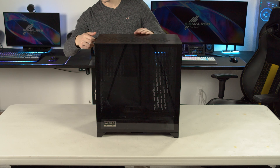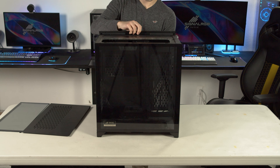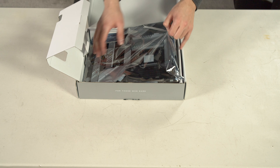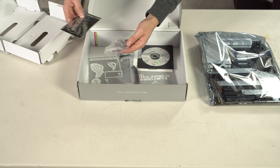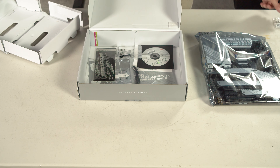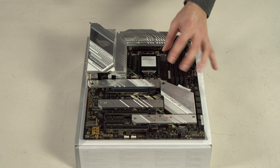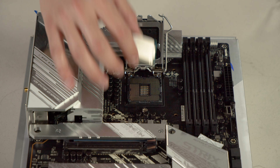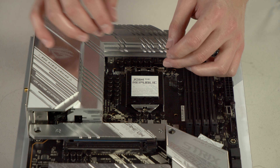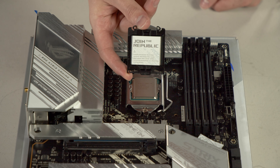The first thing you should do is remove all of the panels from your case — it makes the case lighter and easier to work with. Read your manual if you're unsure how the panels come off, and be extra careful with the glass panels. Next, prepare the motherboard by installing the CPU, RAM, SSD, and the backplate for the liquid cooler. Take out the tiny screws and standoffs included in the box for the SSD. Rest your motherboard on the box for a static-safe workspace. To open the CPU socket, push down on the latch and pull out. When installing the CPU, match the notches on the CPU with the notches on the socket — it's nearly impossible to mess up if you're gentle. Once the CPU is inside, give it a light wiggle to confirm it's seated properly, close the lid, and push down on the latch to secure it. Keep the CPU cover in case you ever resell the motherboard.